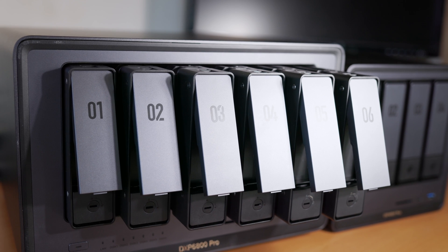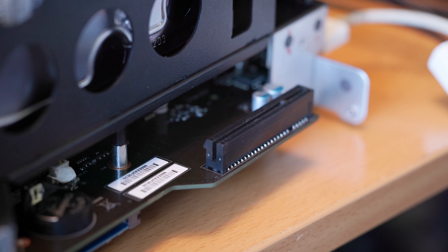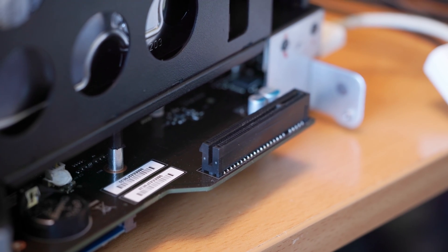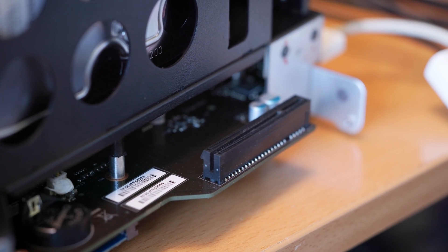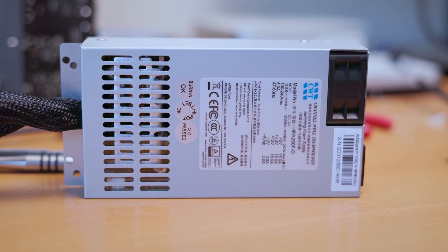Let's take a look at this different 6-bay unit. The most notable feature is two more drive bays, up to 144 TB with today's largest 24 TB drives. It also has a PCI Express slot that you can put any card you want in, and a built-in AC power supply so there's no power bricks. I immediately started testing what all I could put in that slot and how well it works in their included OS and other OSes.